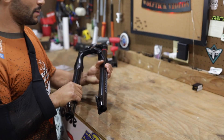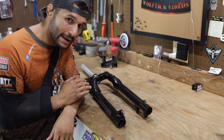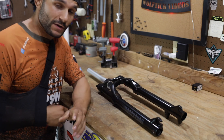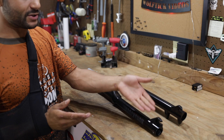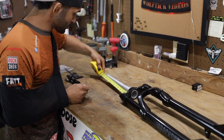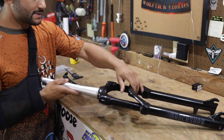We'll put some affiliate links in the description below where we purchased it. It does show in the listing that it was a tapered aluminum steerer - that was our fault, not theirs. It has a 9 millimeter quick release, which is nice - you don't need a through axle or a new front wheel if you're running a budget bike. Let's get into some measurements. Steer tube length is 11 and a half inches and the steer tube is aluminum. Stanchions confirmed aluminum.